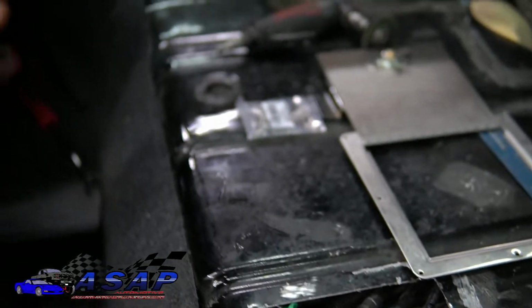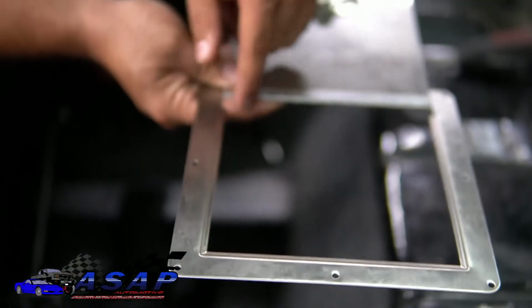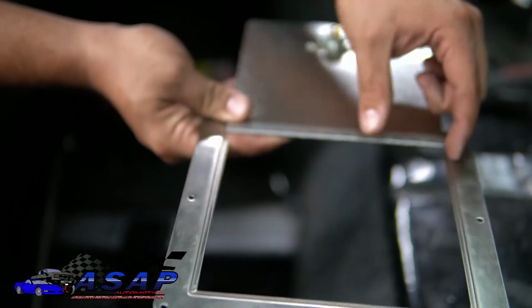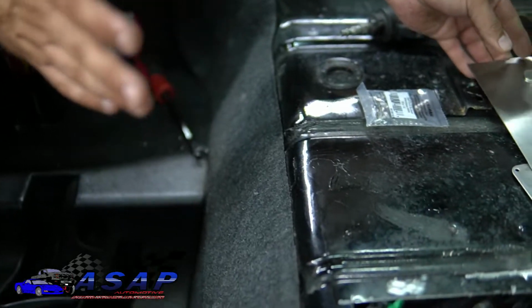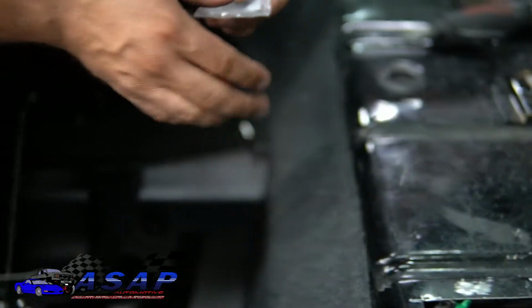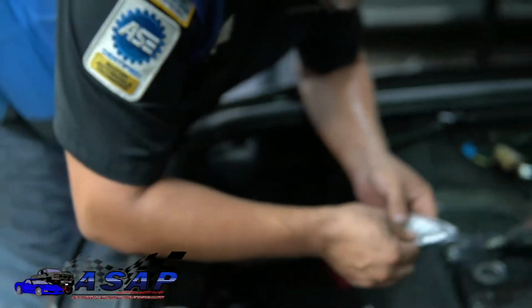It's always easier to take off metal than add. That'll give you some rough dimensions. I'd recommend, especially if it's your first time doing anything like this, mark on the inside. That gives you a margin of error. Then you'll need to come back and cut it out enough to where that'll sit down in. So now that we've got that cut out and everything, we know we're good there. We can go ahead and start mounting our new door on.